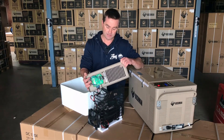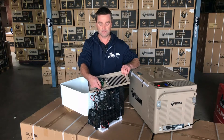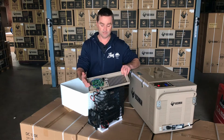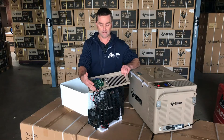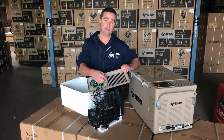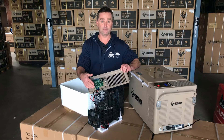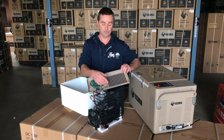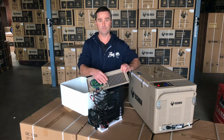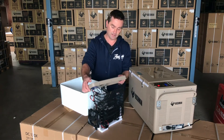The digital thermostat is a simple little module with four push-on connectors and a little thermistor probe, which is the temperature sender. If that thermostat malfunctions — say you drop a rock on it — it's an easy fix: four wires unplugged, four screws, pop it out and replace it. To get you out of trouble we've also got an override switch here. Flick it on and it sends power direct to the compressor and runs it flat out — you become the thermostat, turning it off and on as needed until you get a replacement in. It's hidden away so people don't accidentally leave it on and wonder why everything's freezing.